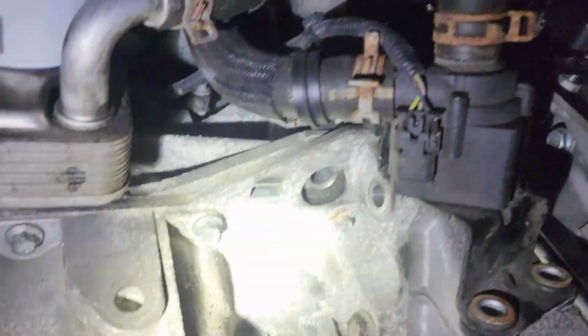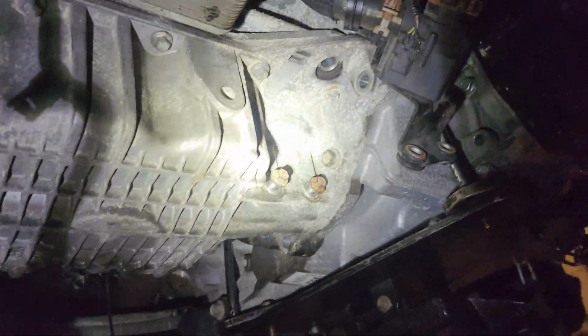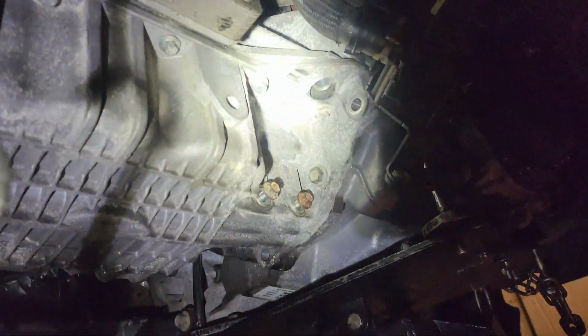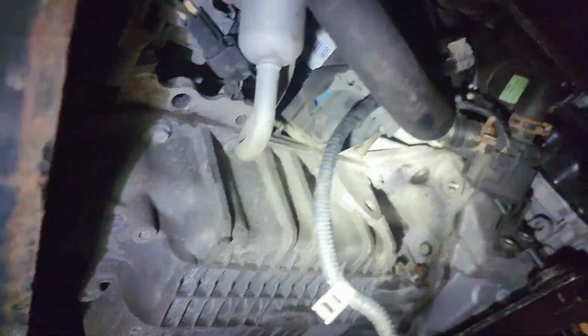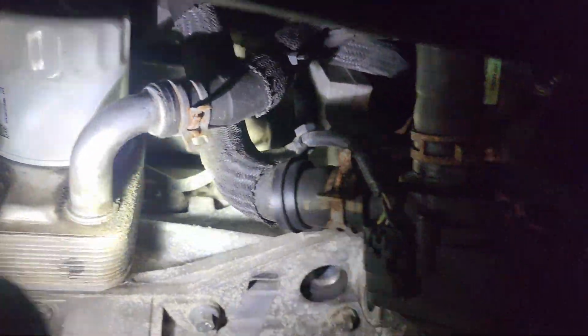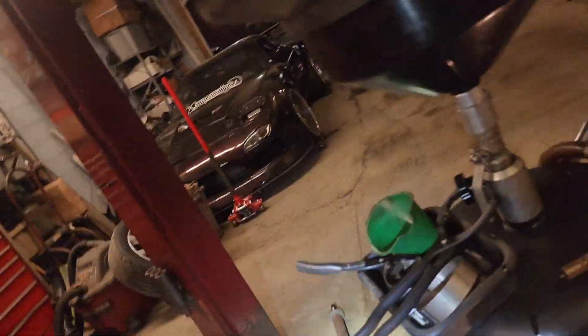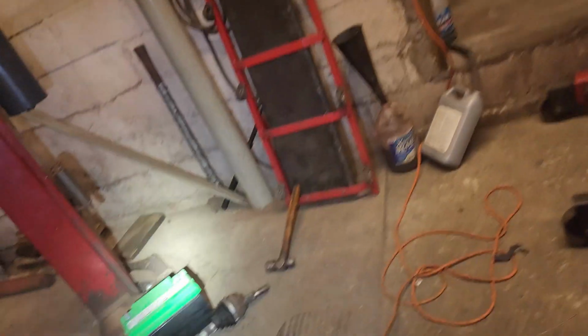I guess dropping the oil pan would be easier just to get the torque converter bolts off the flex plate before removing it all. Because I don't know, boy. How could you cram it, unless you take the intake manifold off, which I'm not trying to do, but we'll see. We got most bolts out, axles are out, both sides. Spindles just laying around. Got the rack unbolted. So we'll see.